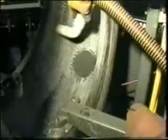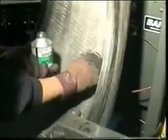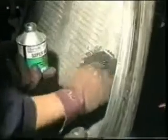Moderni's liquid buffer is sprayed over the damaged inside surface of the tire, and any debris is removed with the scraper. An area slightly larger than the size of the patch is marked with chalk and then buffed. Remove buffer dust carefully with a vacuum cleaner and apply Super Vulcan G to the buffed area.